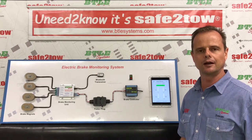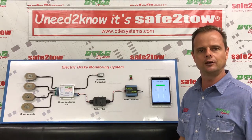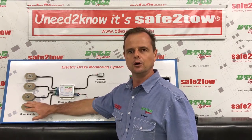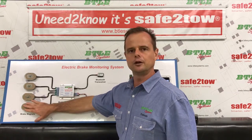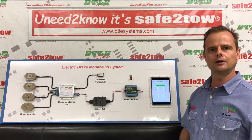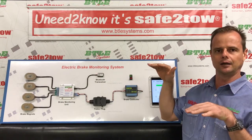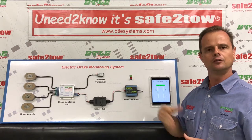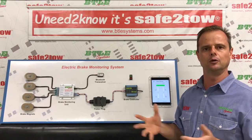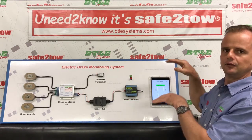But the feature of the Safe to Tow system that our customers seem to like the most is the ability to monitor the mechanical performance of your brakes. The brake magnets contain a coil of copper wire and the resistance of that coil changes with temperature. So if we've got a difference in temperature between the brake magnets, it's reflected as a difference in reading on our bar graphs. We know that all of the bar graphs should always read the same - if we see them starting to read differently, we've got a direct indication of a fault. Mechanically that could be a faulty brake, an incorrectly adjusted brake, a flat tire, or a faulty wheel bearing - anything causing a difference in temperature between wheel assemblies will be reflected on the bar graphs.